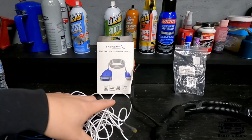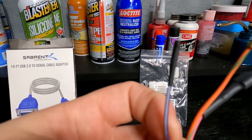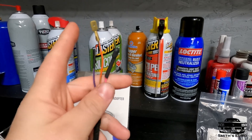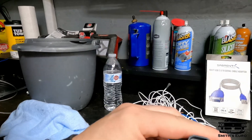I have a mile of wire here to go inside the car to connect properly. Then I have this other wire that's out — it's my flex fuel wire. Eventually we'll get to that, but today it's just left blank. This spare wire is ADC1 and that's going to be used for launch control. I have a little Deutsch connector that goes inside the car — I have a button on my steering wheel that's what I use for launch control.